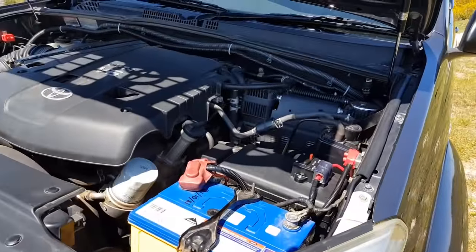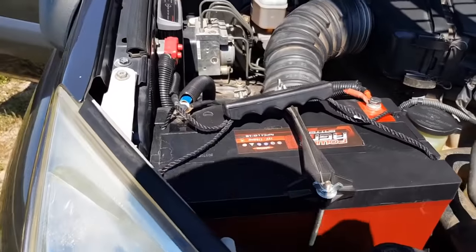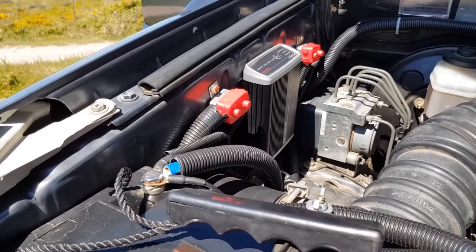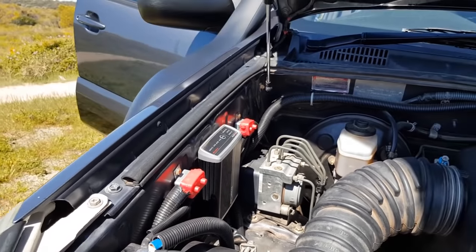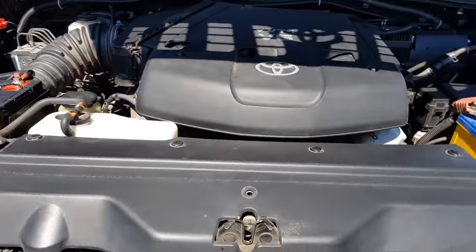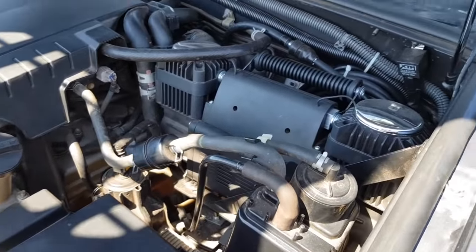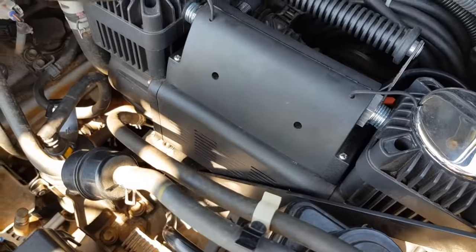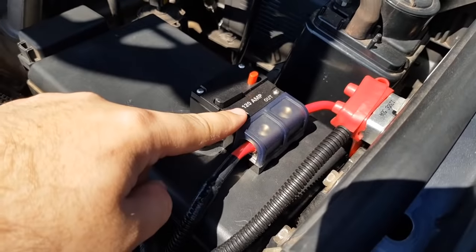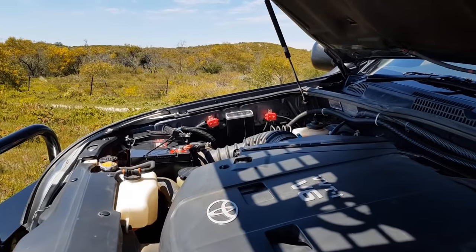The engine is mostly stock. There's an AGM battery — 110 amp-hour — that runs all the accessories, and a DC-to-DC charger system. The factory battery is the starter and there's an auxiliary battery over there. The air compressor is the King's Thumper Max, bolted in on a custom bracket. It's hardwired in with an auto-reset circuit breaker for the charging system.